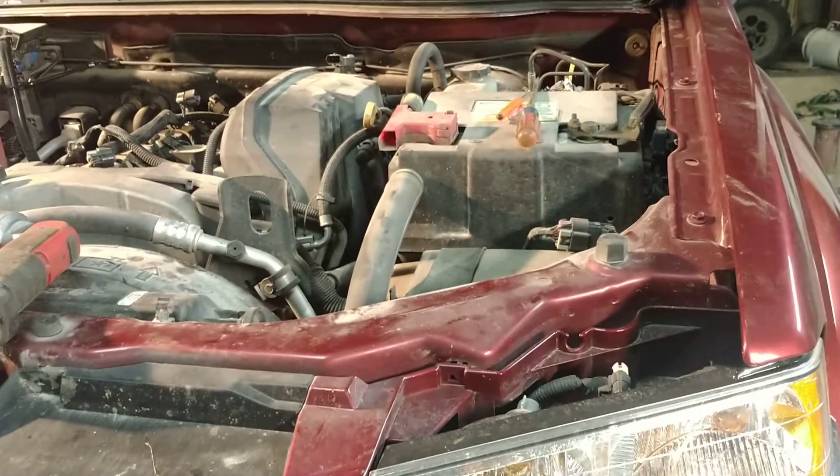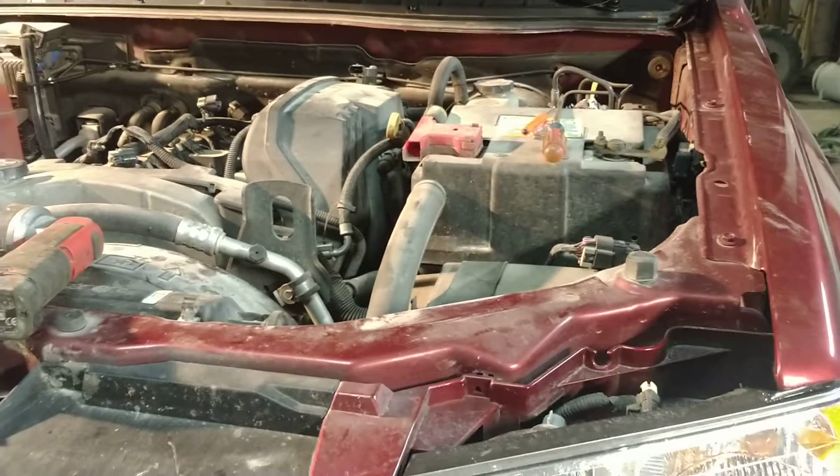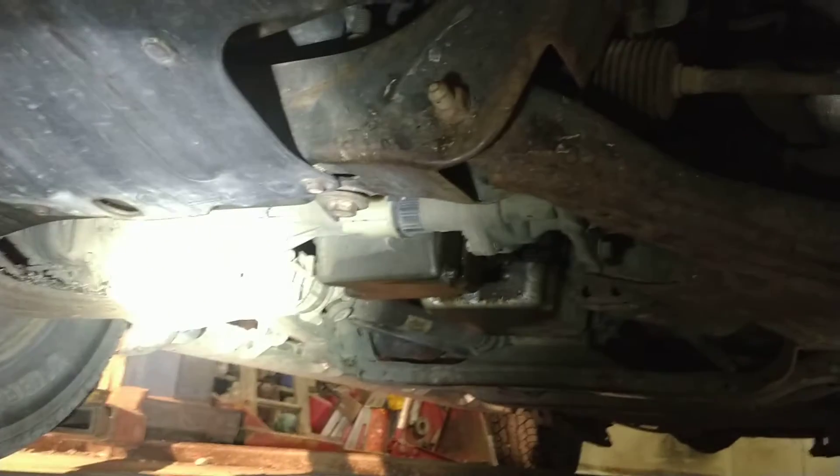How do you get it out? You put this thing up in the air and pull the oil pan off. I don't have it up in the air yet, but this is a Chevy Colorado four-wheel drive, so up in here — right there — that thing is the front axle, the front differential, in the way underneath the oil pan. So you've got to pull the front differential so that you can pull the oil pan so that you can pull the timing gears.